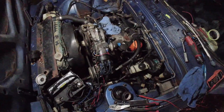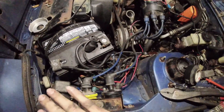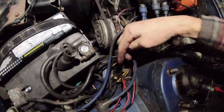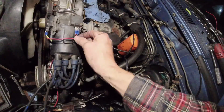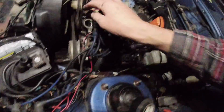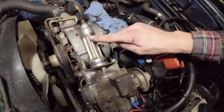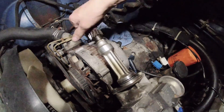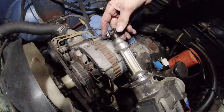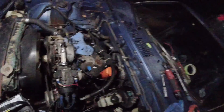Quick explanation of what we've got going on here — let's turn the lights on. The new ignition's wired up. You can see the fresh wires here. I pulled the two positive wires from the existing coil harness to power these coils, bridged them together. We have one red wire that runs over to the distributor, bridged. The green tape is trailing to match the blue connector over here — trailing coil. The other one is not marked — leading coil. The distributor has to be grounded for it to work, which is why it's sitting on the alternator. And if I spin it, you can hear the igniters firing, which then fires the coils. Pretty neat stuff. That concludes getting spark on the blue car.